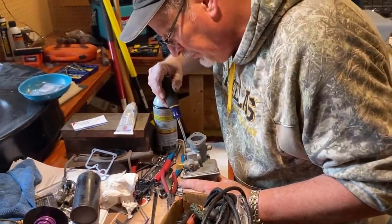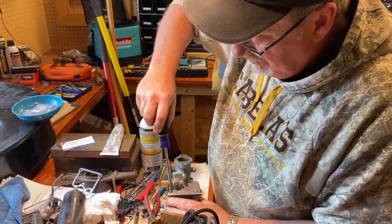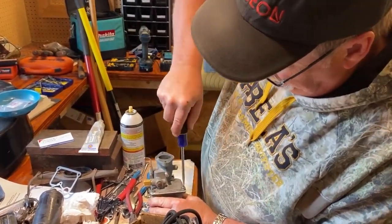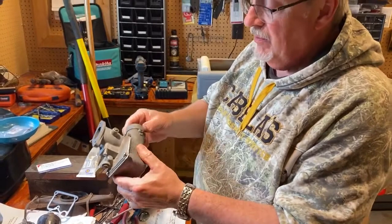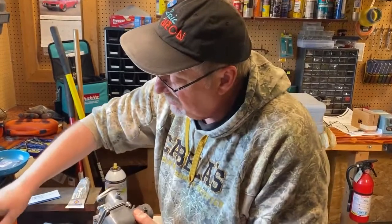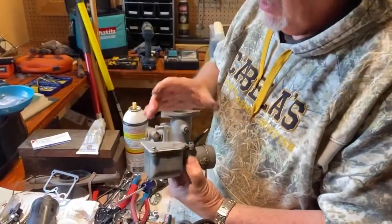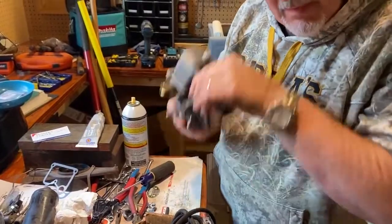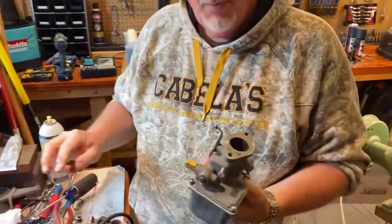Snug again. There, and our carburetor, we'll just let it go. I also put the bottom plug in, because we'd use this float tool to tell us how deep the float bowl was getting, so we knew if we had to adjust the float. I hear the float still loose in there like you want it. Now we'll go put it on the car.